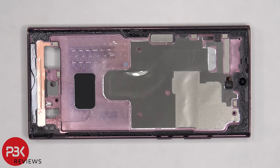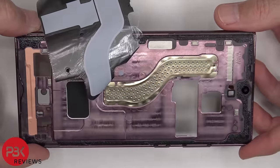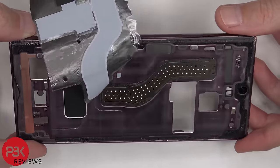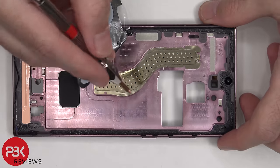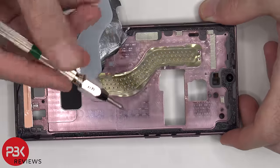Once the screen is removed, there are layers of graphite to help transfer heat. Once the graphite film is peeled off, we have a better look at the stainless steel vapor chamber. The stainless steel may look like copper due to the color, but it's color treated — I tested it with the Mohs hardness scale and verified it to be stainless steel. Copper usually scratches at a 3 and stainless steel around a 6, and by testing it I was able to see scratches starting from a number 6.